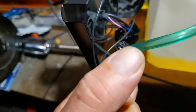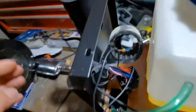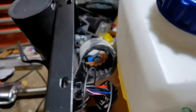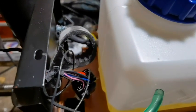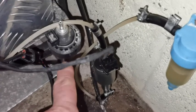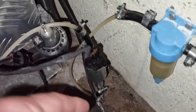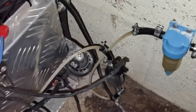With the pump, just pull that off the top of the pump. When you want to take the power connection off, just push that in like so - that'll disconnect the lead. Pull that back as well, and on the bottom of this one we've got a little short rubber hose. Undo that, take him out, and slide him from the bottom up because you can't go the other way because of the connection here. We've popped it into the other machine.